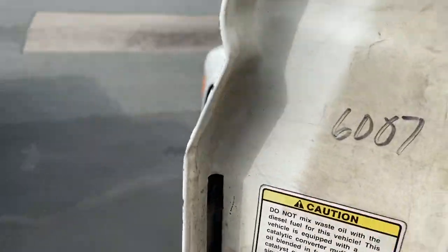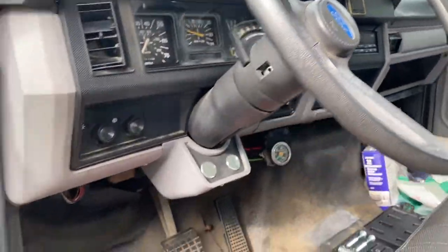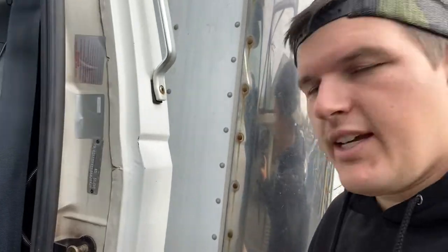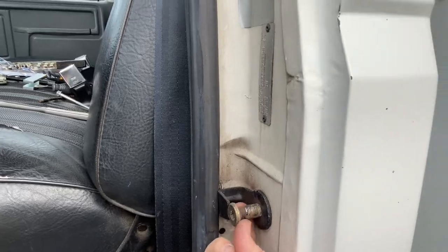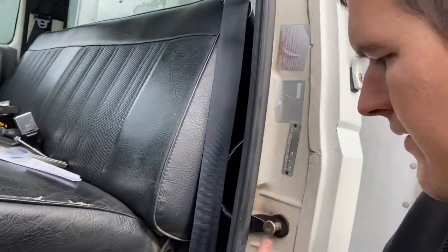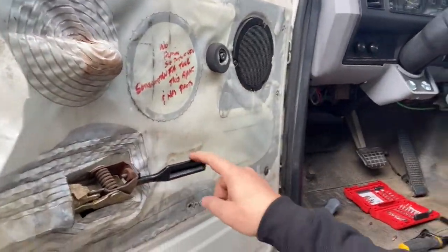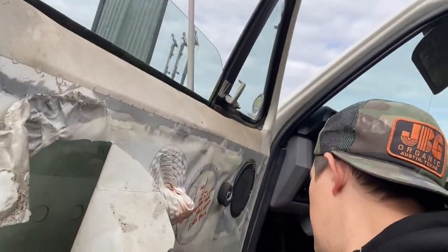Next we'll want to pop these out and get a new key set for the outside doors. Now that we have keys on the inside, that will prevent anyone from taking our truck. On the door latch you can see they're kind of grooved just from being older and used a lot. We got this little kit — they're filler sleeve pieces — and we'll pop that out and put the sleeve over it. That'll keep the doors from rattling, because the only thing that's really loud when driving is the doors rattle a little bit. We'll do the other side too to match.